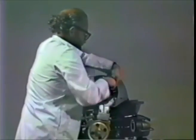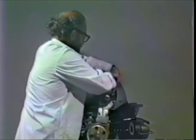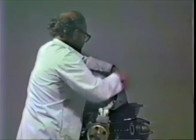On really nice engines, I gold plate them. You gold plate the same things the factory CAD plated. It's the same process, only using a better material, gold instead of CAD. And the net effect when you gold plate the bands and straps on the coil, filter can, generator, pulley, pulley nuts, and with one exception, this piece here, you really can't beat it. It looks fantastic. Doesn't cost that much to do.